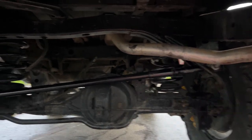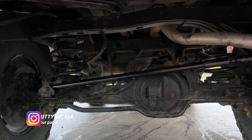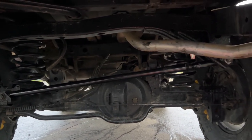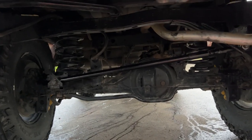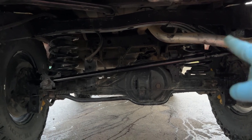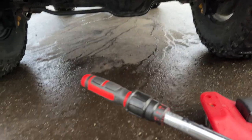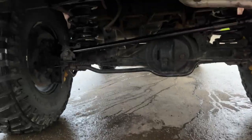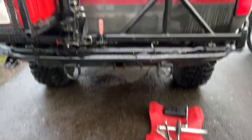When I took out all the bolts I took the time to wire brush them so all the threads are clean, then went ahead and put some anti-seize to make it easier in the future. Once you do that, make sure you torque it down - the spec is 127 foot-pounds; I did 130 foot-pounds on my new Craftsman torque bar. That's pretty much it for this video - hope you guys enjoy and I'll see you guys next time.